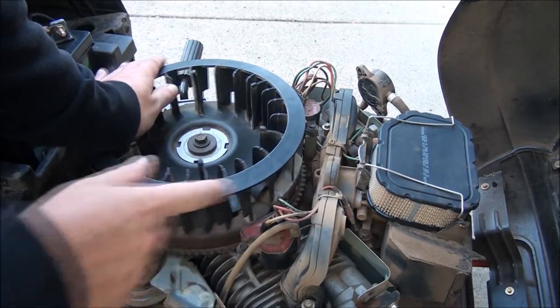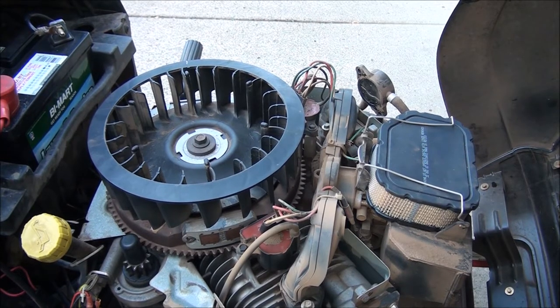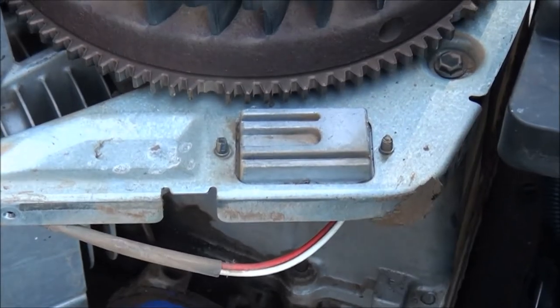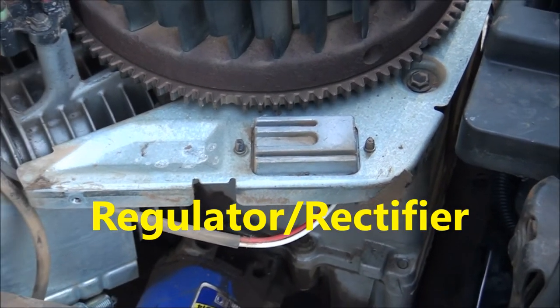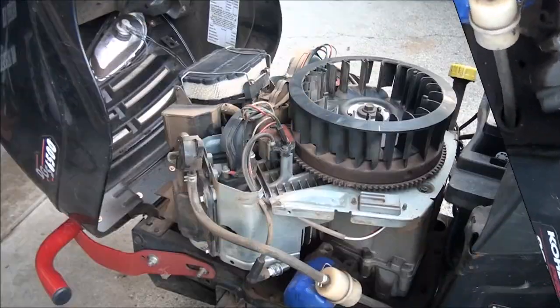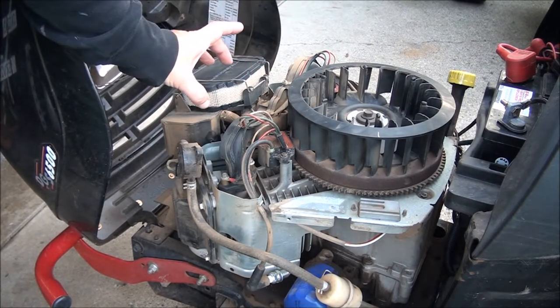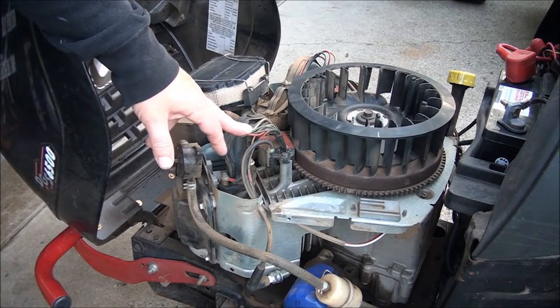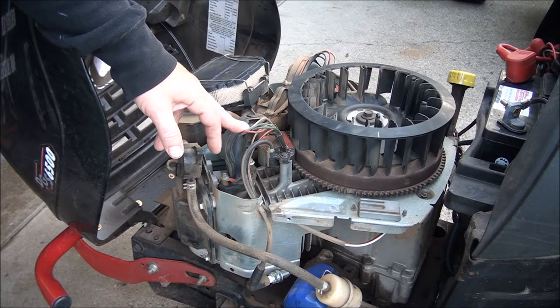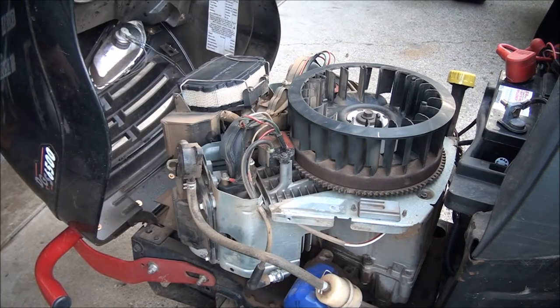Just when this magnet here spins by the coils it creates the spark. That's a proper ignition system — that's the way lawn mowers have been doing it for decades. I don't know why Kohler thought they needed to change things up. This component here I think is a voltage regulator, because the wires look like they go up underneath to the stator. This is a 2006 or 2007 model, and I don't see any other electrical component other than these two coils and this regulator rectifier.